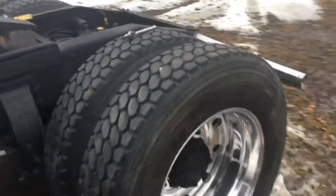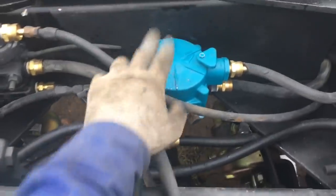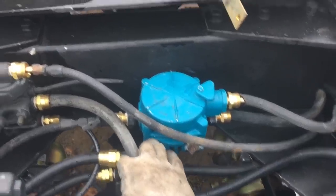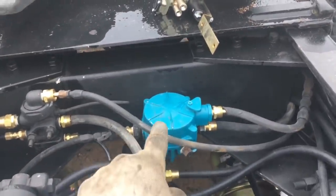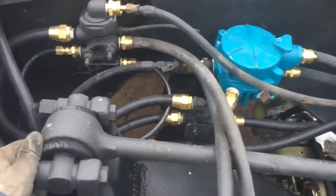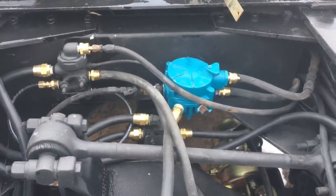I've been trying to get some work done on the airlines and picking away at this. Last weekend when I replaced a line — the one that was original — I backed it out of the relay valve and of course steel and aluminum don't play nice together and it sheared off. Rather than trying to dig it out and muck up the old threads, I figured just get a new relay valve — it probably needs it anyway. This one matches the same one underneath the frame, so I'm just continuing to work at it.